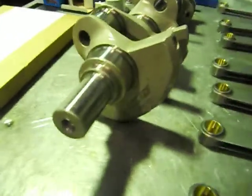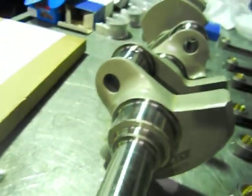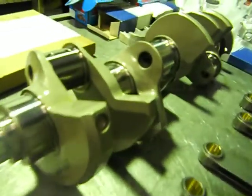And here's our little puppy here — our four-inch stroker crank. It's a 4340 forging. It's been gun barrel drilled through the big ends just to reduce weight.